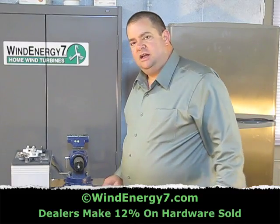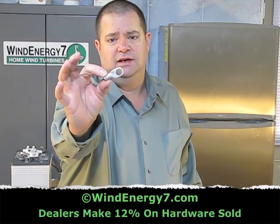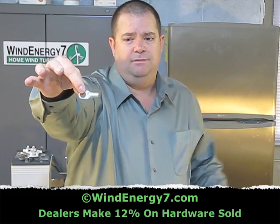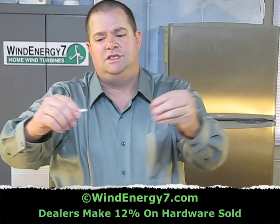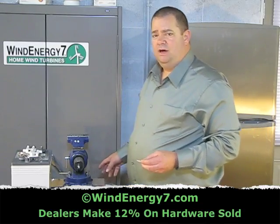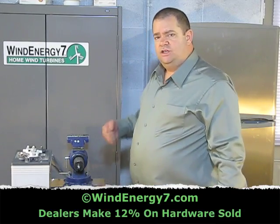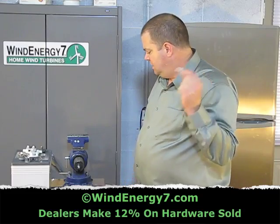The other thing you've got to do with battery cables, besides cut them and measure them, is terminate them. To terminate them, it takes lugs — these are lugs. It's got a hole where you stick the battery cable down into it, and then you crimp it right here so that it squeezes and will no longer come loose from the cable. You stick the cable in and crimp it. One way is a vise. A vise is probably the second best way to do it, but it works great. You put your cable in, stick it in the vise, crank it down, and squeeze it until it won't go any more. Then your cable is crimped and won't be coming loose — you've done a good job.